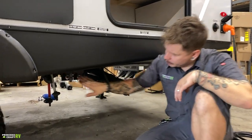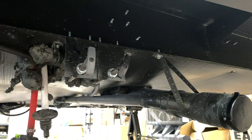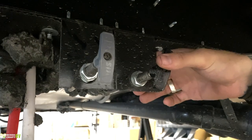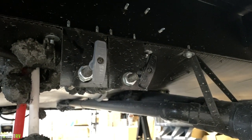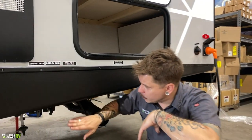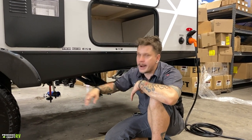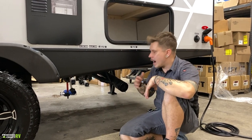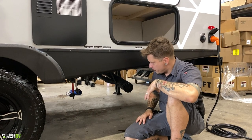Also, treat these two valves like a vacuum lock. They should never be opened at the same time. We want to make sure that we are avoiding any cross-contamination or anything like that. A popular option when it does come to dump is going to be opening up that black water valve, allowing that body waste to evacuate. Once we are certain that it has evacuated, we close that. We then open up the gray water. Being the relatively cleaner of the two, that's going to rinse any shared plumbing between the two.